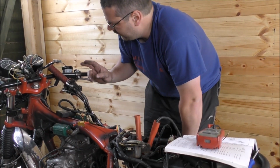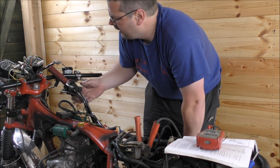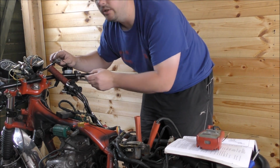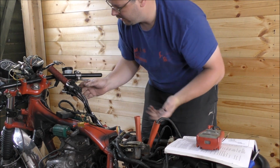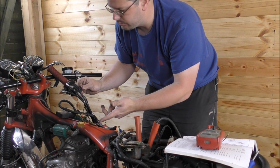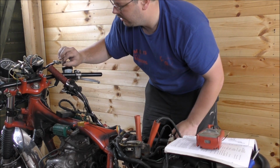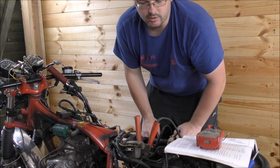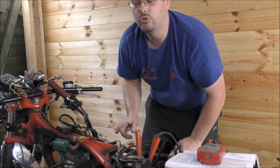We've connected up the run switch and the electric start switch, and I've jerry-rigged a wire, hot wiring, like in the films. So that gives us our ignition. You can set it to run, I get power up the coils, that's good, and it cranks. So, get the carbs on, chuck some oil in it and an oil filter. We should be able to give it a go.